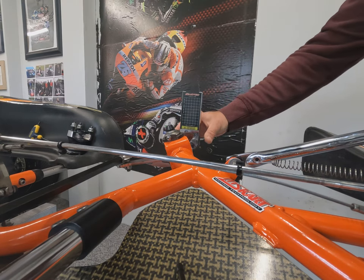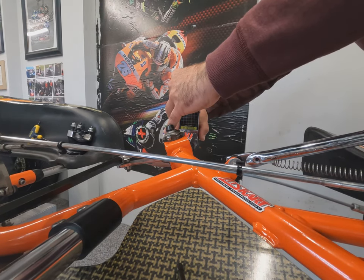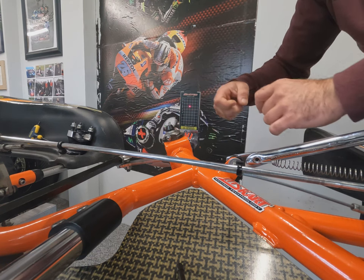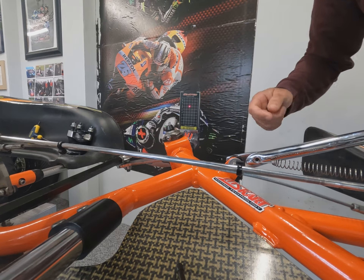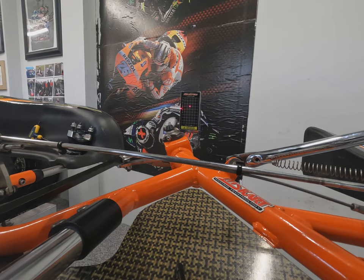We've got our laser alignments on — slid up to the 15mm spacer we've selected — levelled the spirit bubble on top, and turned the laser on. Always check alignment with the level on top. With both lasers on and level, we turn the steering wheel until both sides show equal readings. On both the left and right side we've got the laser bang in the centre — zero camber, zero toe. Now we know the steering wheel is in the equal position.